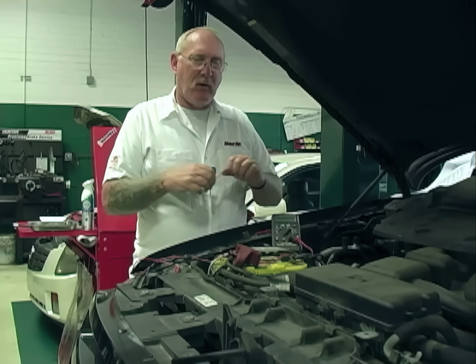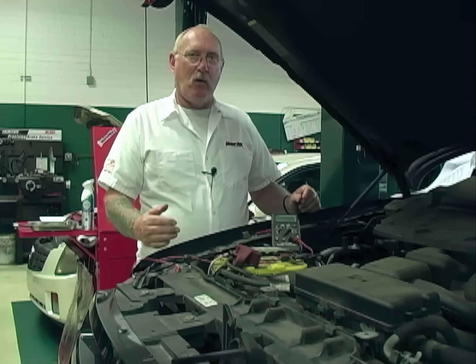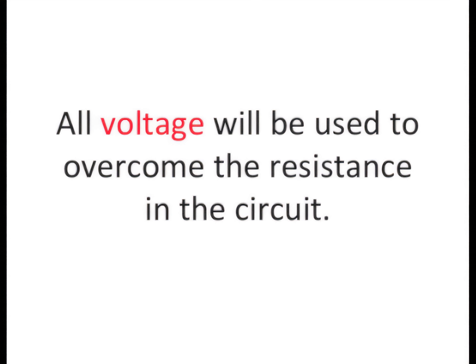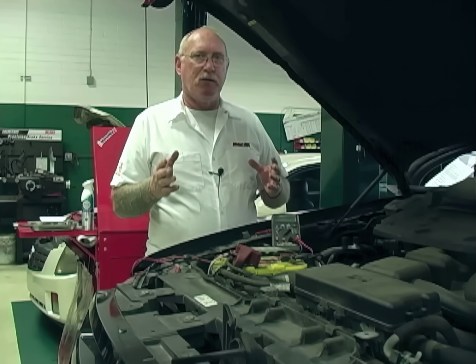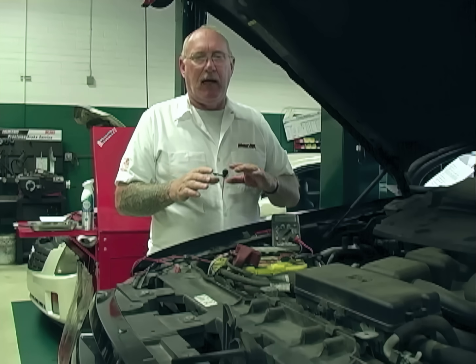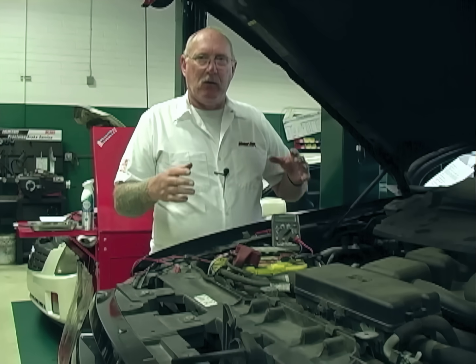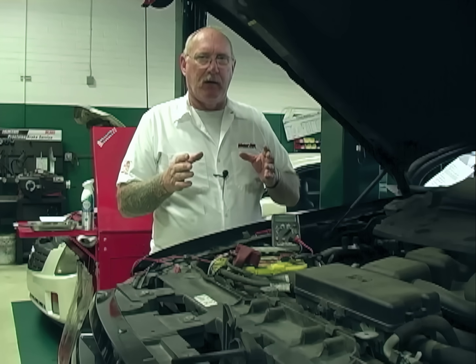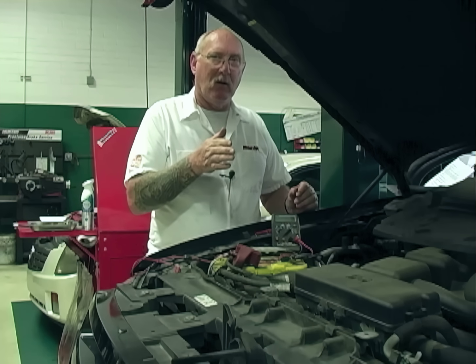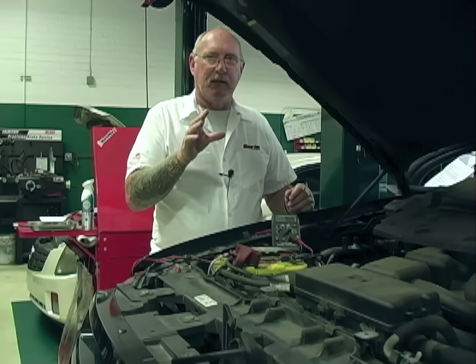Think about it for a moment. If I break a wire, that creates a huge change in resistance — enough so that current will not flow. And if resistance drops straight to ground, a short to ground, isn't that a change in resistance as well? Here's another electrical 101 basic: all voltage will be used to overcome the resistance in the circuit. That means if the load is supposed to be the only real source of resistance — and yes, there's a little bit in the wire and connectors, but that's minimal — then the load is the primary reason for resistance, and I should measure near battery voltage on the positive side right at the load and measure almost nothing on the other side.